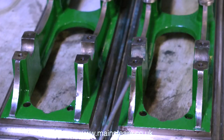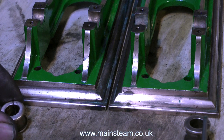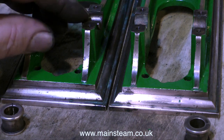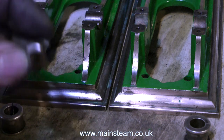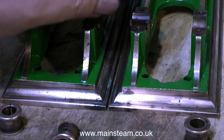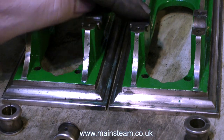All of the parts of this engine are carefully numbered as you can see here. I'm not a great fan of this — I don't mind the numbers but I wish they wouldn't put them in such a visible place, but that's the way it is. Each of the half bearings has a number which goes into the corresponding slot which also has a number, and this makes for a very easy and accurate reassembly of the parts, especially on engines that are not very well made. But with this engine, because it is very well made, the numbers are a little bit superfluous — everything fits really well.